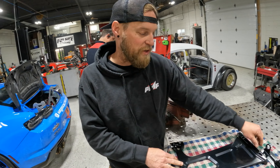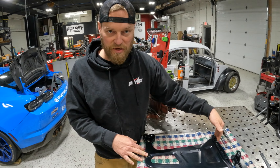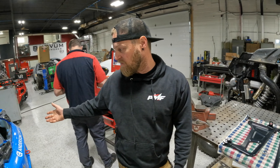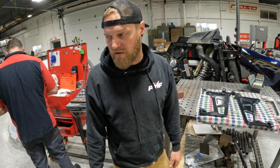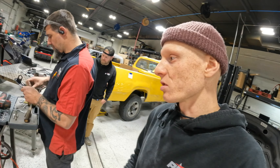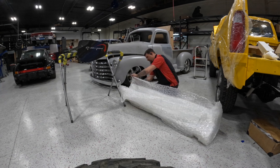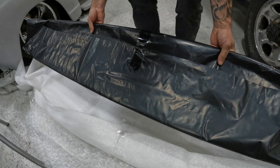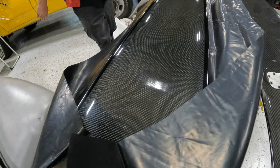The actual swan neck wing mount pieces are considerably lighter because they're not layered. They're also a lot stronger than sheet metal pieces that are welded together. These are such a cool design — it's almost a shame that they're a one-off piece. If you followed the red Camaro that we built, that's kind of where this design originally came from. We've wanted to do it in a more repeatable way, so moving forward we may make these out of two pieces where the base comes off and can be adapted. All we have to do is make different bases for different applications to match the trunk lid, and the uprights are pretty straightforward — a little cutting, some MIG welding, and you can drop them in. You can even just send us the spacing you need and we can adapt it to almost any car.